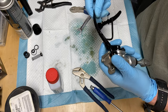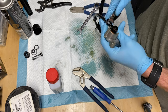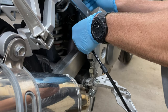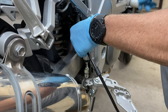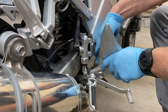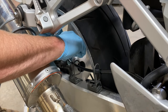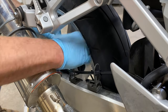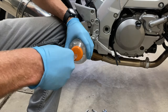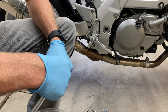I'm a big fan of these Venhill brake lines. I previously did my front brakes with Spiegler brake lines which work great too, but the adjustability on the Venhill is better — you don't need a special tool to move the banjo bolt around. It just has a lock nut and you can position it wherever you want and then lock it. The only issue reinstalling was that the line guides were kind of in the way with the angle of the line, so I removed all of those — it's tight enough that it doesn't move around and it loses a little weight.